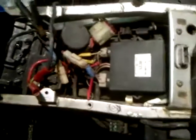What I just checked that was interesting just a minute ago is the battery water was really low. And here I am wondering why it takes a jump starter to crank the thing over, you know what I mean? Well, obviously right there. I don't know why I didn't check that earlier. The volts seemed low, but I want to see what happens with the thing properly full of water to match all the cells, and a good charge. As you guys can see, I've got my old reliable jump starter/charger on here for a trickle charge, and I want to see if I can get those volts enough to reliably give it a cold start.